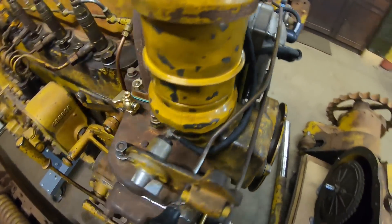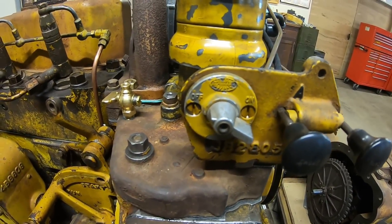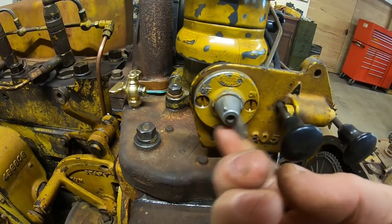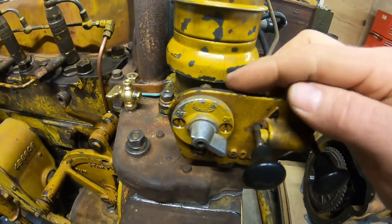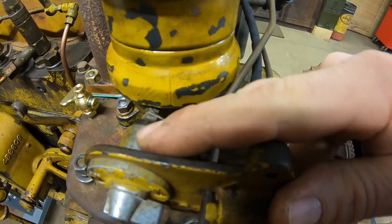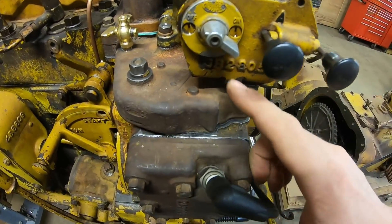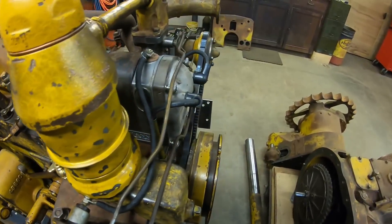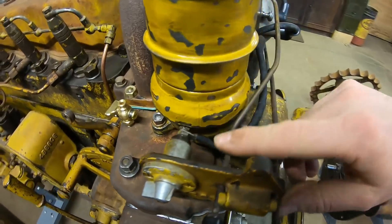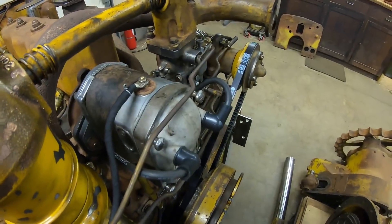The wire is in place from the mag to the switch — this is also the original Eisman switch, and I didn't even have to take it apart; it works perfectly. It's a contact switch: in the off position it allows the lug to be grounded to the case, the case contacts the bracket, the bracket contacts the chassis, grounding the mag and cutting the spark. In the on position it just breaks contact from that lug to the body and the magneto can spark away.